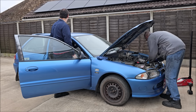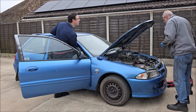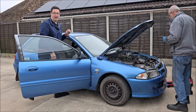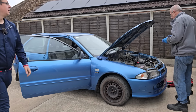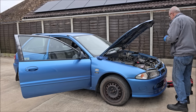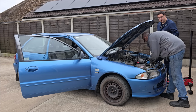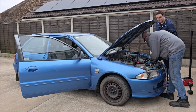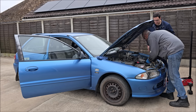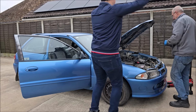What are you hoping to see? Go on, son. Ready? Yeah, go on, mate. 200. Hey! It wasn't running very well on that cylinder. So what we're finding now is, have we got an injection problem? What I'm saying is we've got compression now, haven't we? Which is good. Can't grumble at that, meaning the engine may not be knackered at this point. Looks to me like it was washed bores and valve clearances up to now. But no, that engine's not knackered.